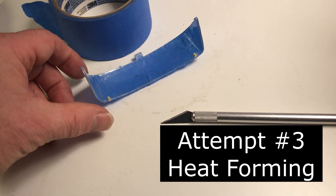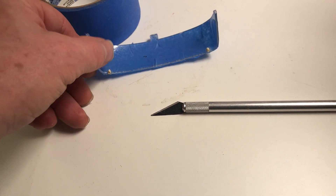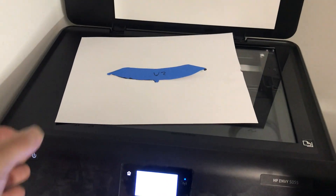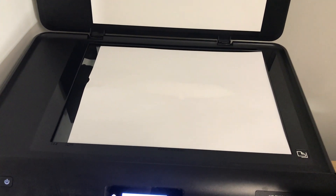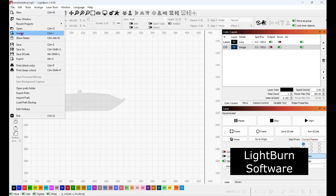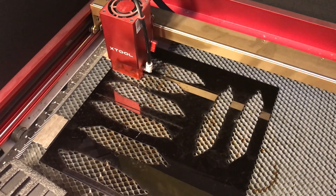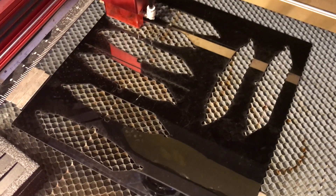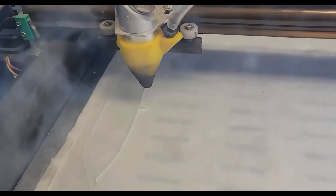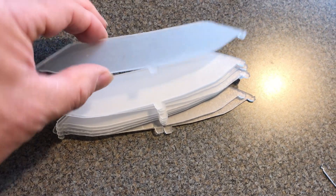I took the plastic boat original windshield, covered it with painter's tape, and then cut it out to make a template. I used my old HP bed scanner to scan the tape and that created a metric photograph. I loaded the scan photo in and used the drawing tool to draw around the outside edge to create the vectors. My x-tool LED laser is 20 watts so I can cut black acrylic but I can't cut clear, so I made some sample pieces. My friend Jim out in California has a CO2 laser, so I had Amazon ship him some clear acrylic sheets and he cut me out a whole stack of nice windshields. I'll put a link to his video above here.